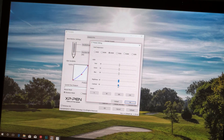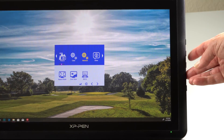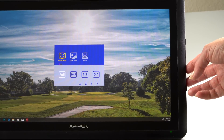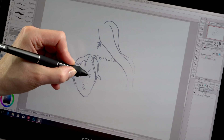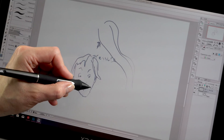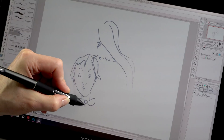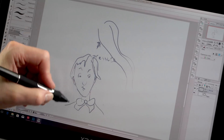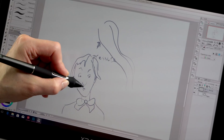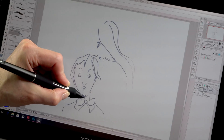How is the display quality? The white point was all over the place. There are on-screen controls — much like a regular desktop monitor — to control brightness, contrast, and backlighting levels separately. You can choose a high-contrast mode, which actually didn't seem to do anything. They claim 1,000:1 contrast; I'm seeing about 500:1, tested with a couple of different laptops. And though the color gamut is wide, the color calibration is atrocious out of the box — you're going to want to use a colorimeter to get it right. The white point is kind of high; the gamma is pretty decent. It's a lot less than a Wacom Cintiq and it's going to take more tweaking, but you're paying accordingly.